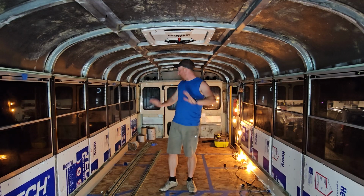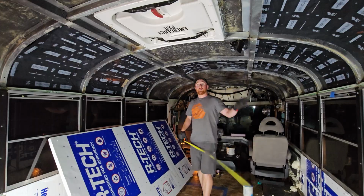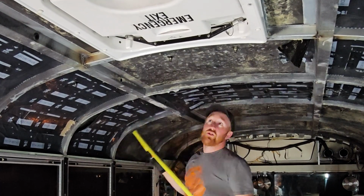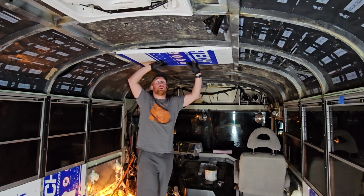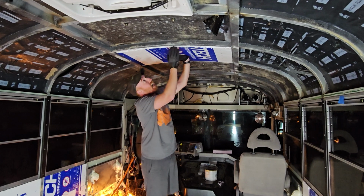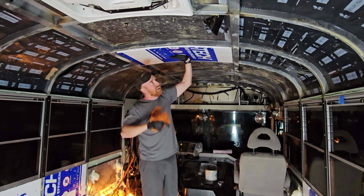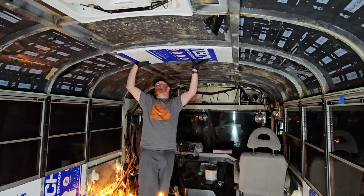It is looking a lot better. So now you're going to find out these spaces down the center. I'm going to put the insulation in those first. So with it cut, just doing a quick double check, make sure it fits here. Definitely have that 1-inch gap right here, which is unfortunate, but I'll be able to fix that later. This fits perfect.